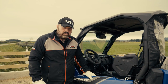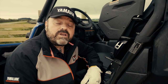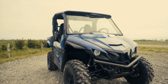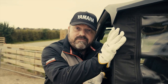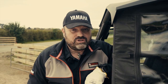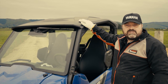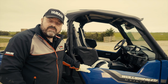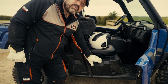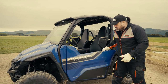As with the X2 and the X4, the Wolverine X2 Utility has a certified roll cage adding to the long list of safety features. The roll cage meets ISO 3471 standards, ensuring occupant safety at all times. Incorporated into the design is a vertical B-post hoop that prevents the vehicle over-rolling beyond the horizontal, making it much easier to exit the vehicle should that happen. Now standard on the Wolverine X2 Utility is a roof protecting the occupants from rain or shine. Another great safety feature is the fuel cap, now hidden behind the passenger door, keeping it sleek and protecting it from damage. The Wolverine models now incorporate a full width door, making it very easy to get in and out.